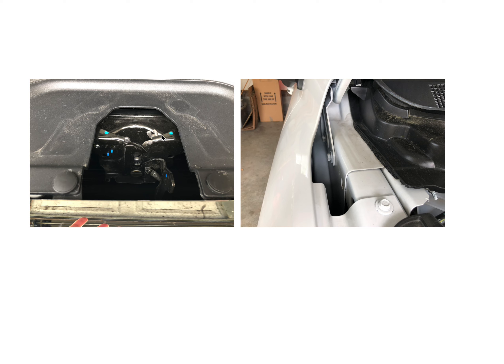I don't drive over 70 miles an hour very often so I don't see hood flutter as much, but when I did I noticed it, and that's what caused me to find a solution. The solution for me was to adjust the hood latch mechanism.